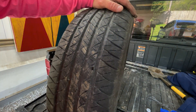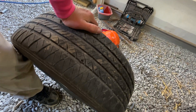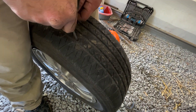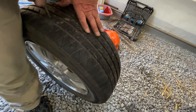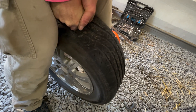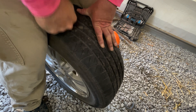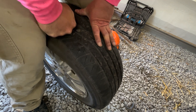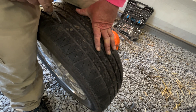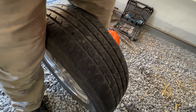I'm going to have to set the camera up and get it on the ground. There we go — that let all the air out of my tire, it is flat as a flitter now. Just get it in there and stick it in that hole. When you get it in, just kind of work it up and down a little — it separates the fibers and cleans out that pocket.